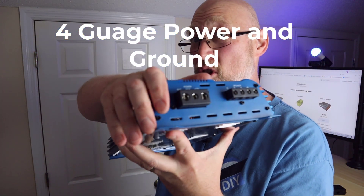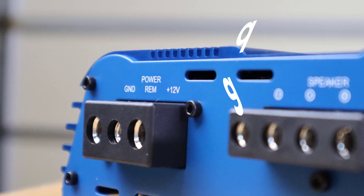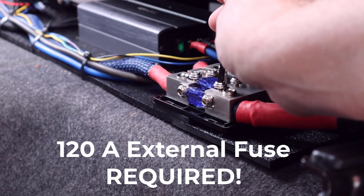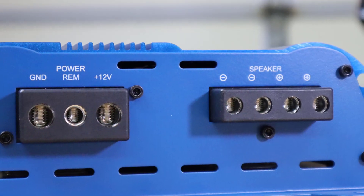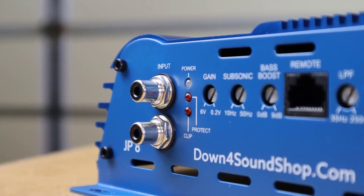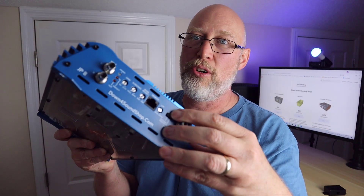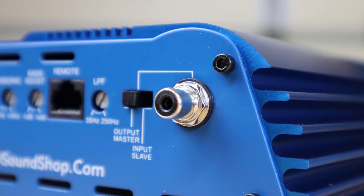These are four-gauge terminals, which is what you should expect for a thousand-watt amplifier. Zero gauge is nice but you don't need zero gauge to run this amp. The speaker outputs appear to be about eight gauge. There are a pair of outputs but it's a mono amplifier — you've just got two connections to make it easier to hook multiple speakers up. On the other side you have RCA inputs, a row of LED lights for power, protect, and clip, a gain control, an infrasonic filter, a bass boost, a low-pass crossover control, the plug for your bass knob, and controls for strapping it with a second JP8 amplifier.